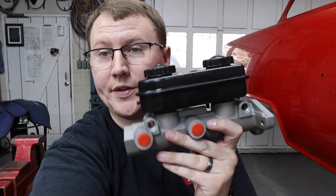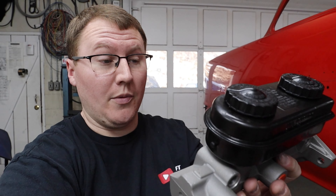We also got a new master cylinder from Strange. We're using a master cylinder that mounts in the floor - you can see it back there. That master cylinder has sat here for a really long time and we don't 100% trust it. This new one was about 60 bucks, and it's worth it to get a fresh one in the car. It's a Chrysler-style master cylinder, mounts exactly the same, and the diameter is exactly the same as the one we have in there.